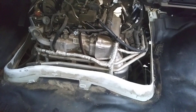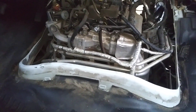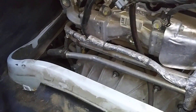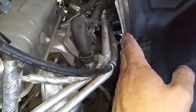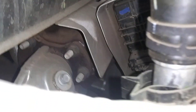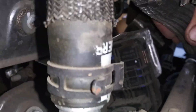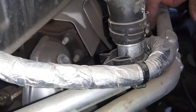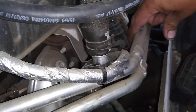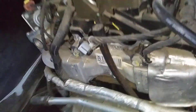I was curious about whether a van body swap for the 2.8 diesel is possible — specifically, will the gasoline engine van body with a smaller doghouse opening fit over this engine? It appears that yes, it will, if those two metal cooling tubes are relocated. There's no reason for them to go that far out; they could be put higher up. The vacuum line is easy to move out of the way. The turbocharger here would be difficult to move, but there appears to be about two and a half inches of space — just enough to fit the gas body over.